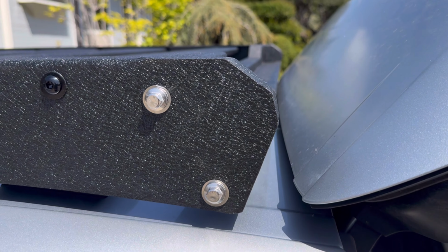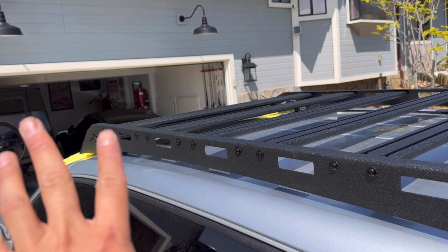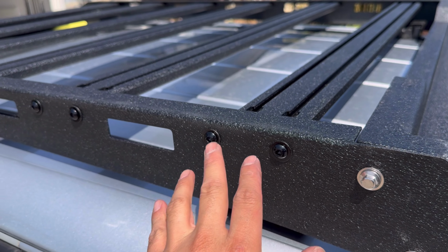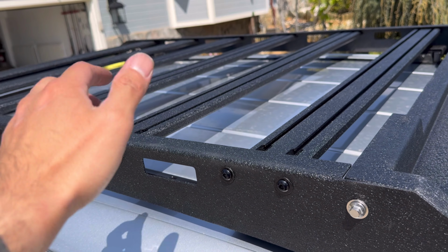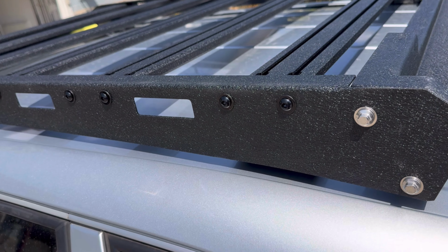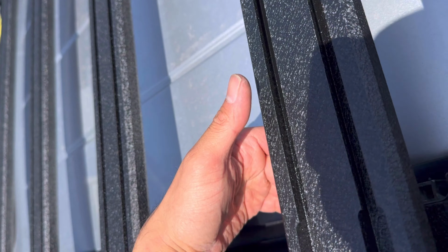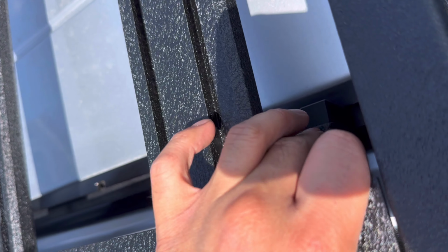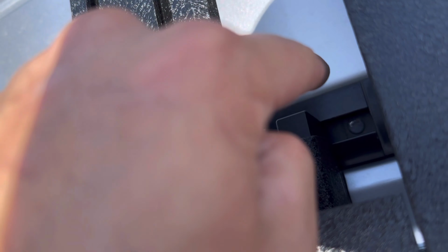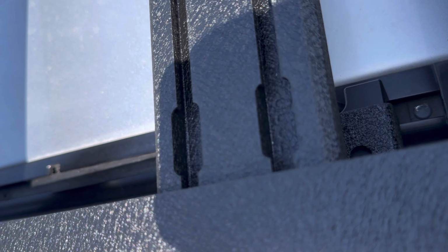All right, guys, we got the mount to clear on the back. And everything aligns. I have to use my mallet and just smack the brackets into place, because once you get them in the actual rails itself, it's a little hard to move around. So I was inching it forward or backward to help align the mounting points from Hooke Road right there. Like right here, for example, you can see it's lined up with the OEM bracket perfectly. So I'm gonna lift the rack up, tighten those exactly where they are so that nothing moves, and then we're good.